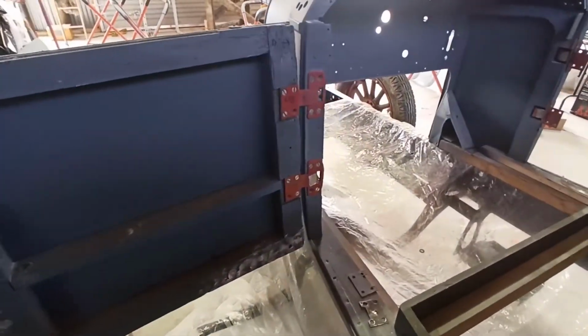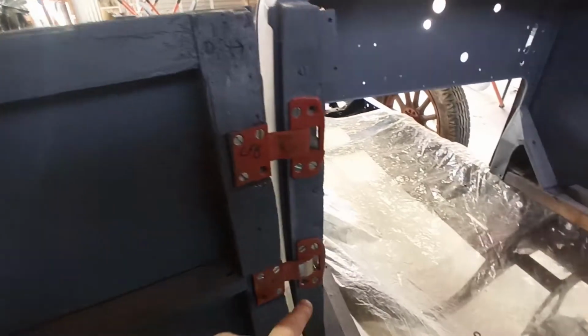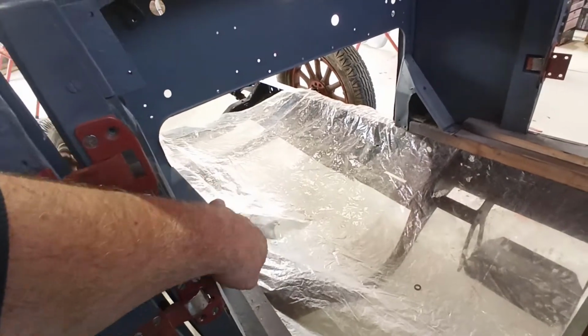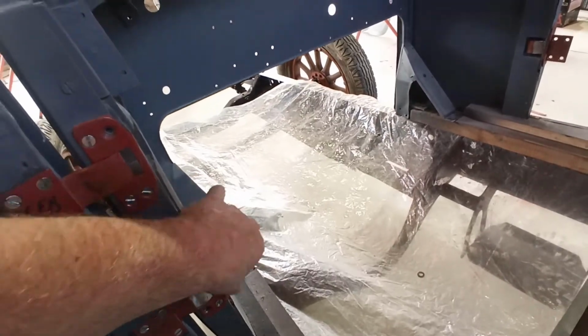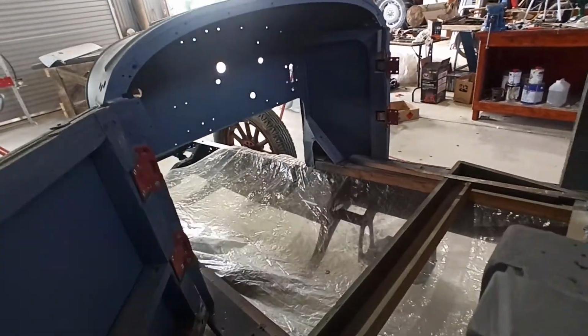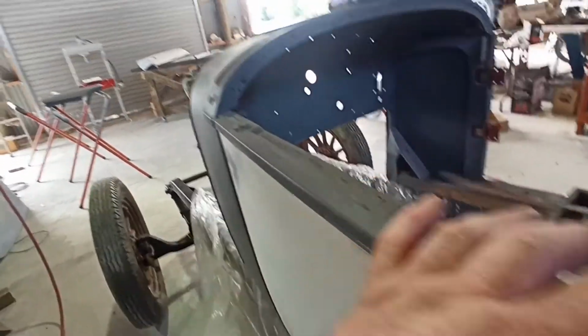Right, I'm just in the midst of working on this door. I've still got the other one clamped up. So I'll put another shim in here, and then I run into the issue of this here rubbing. So I've only taken a little bit off here, and I'm taking a little bit off the back edge of the steel piece there, this piece here. I've just chamfered that edge a little bit so it doesn't catch anymore. It might be just touching. Might have to clear it a little bit more, but I wouldn't say it's brought me 100% right, but it's improved the situation.